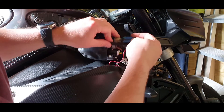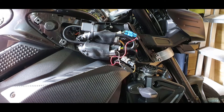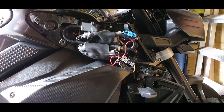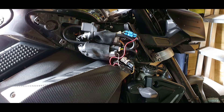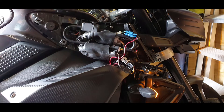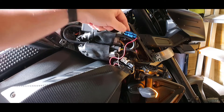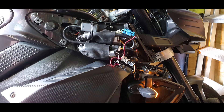Side panel off. There's a switch feed on this side. I've already got DRLs running on the bike - I've already got a Custom LED product fitted here that keeps my indicators on orange all the time. When signalling they flash and stay on, so that's why I've already cut into my switch live here and have these connectors here - I'm going to take all that out.